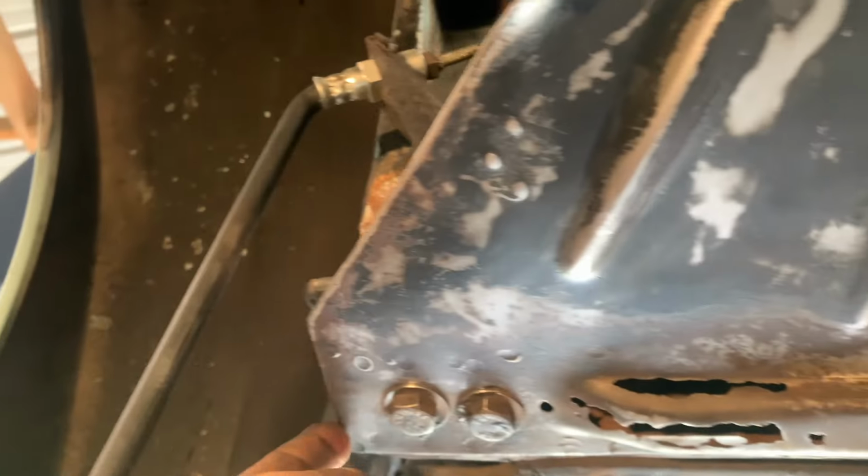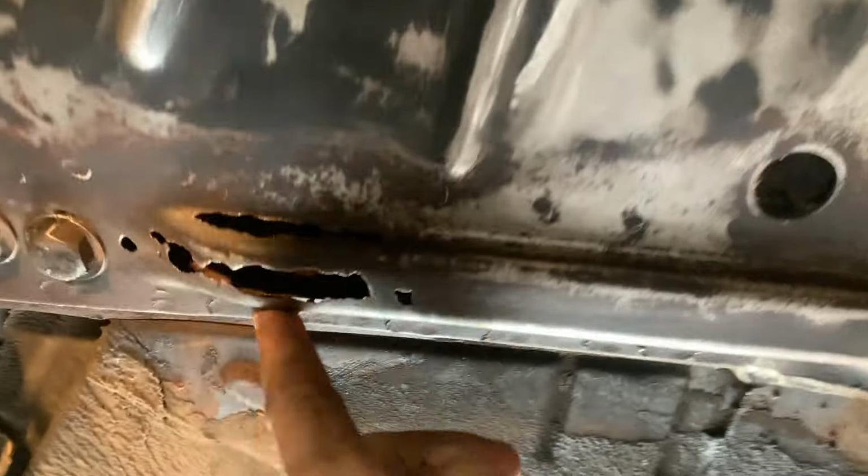And this lower skin right here on the front of your tunnel, this lower skin drills off. See all these spot welds right here? You drill all of them out just like you do on a floor pan. There's some of them right here. You row them across the back. You drill all them out. Cut this weld right here. This is probably the hardest part because it looks like a pretty solid weld. So you cut that loose and then that lower skin will come off.